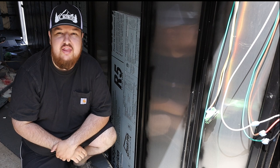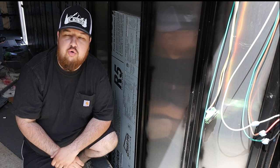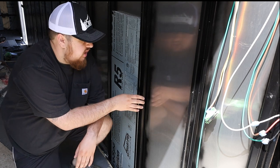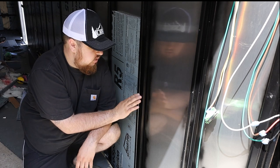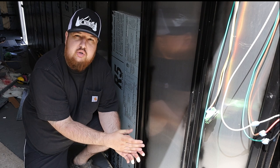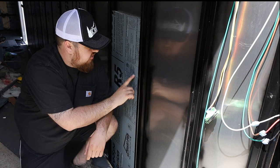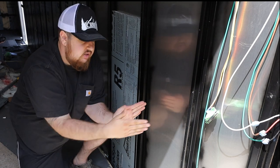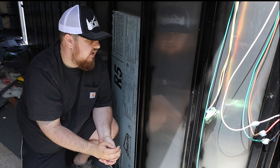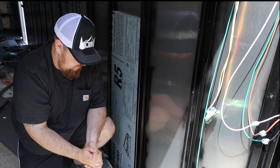Hey everyone, we are in the installation process right now — we've gotten about half the trailer done. I just want to go over the process with you guys so you know what I'm doing and how I'm making it work. My frame is not a square tubular frame, it's like a U with two wings on it, so the tough part is getting the insulation behind it. What we're actually doing is cutting the insulation to the width, then we score it down the middle and break it in half. But it's got this plastic material so it doesn't actually break in half — we can shove the two sides in, push the middle, and it closes tight. That's the only way to really get a snug fit and get the insulation either side of these lips.